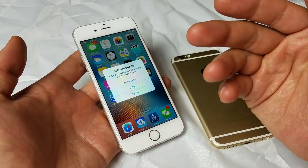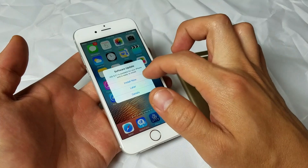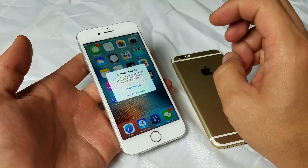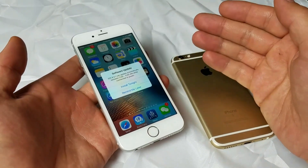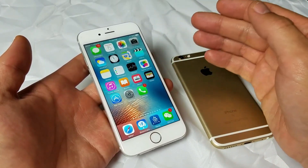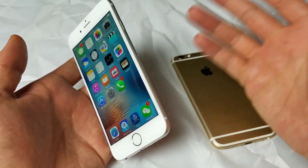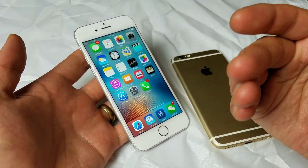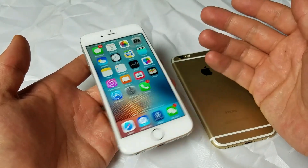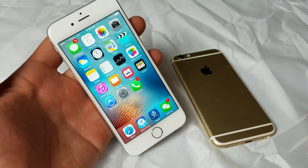If your phone is still not working, you can retry all these steps again. If it still doesn't work, it's possible that you need a new SIM card. It could be a software issue — maybe you need a software update or some kind of patch. It could be a hardware issue, like a chip that's corroded or maybe it got wet. It may be the interior antenna as well. You may also have to input your APN settings manually depending on what carrier you have. If you guys have questions, just comment below. Thanks, guys. Bye.